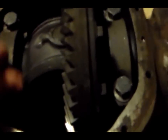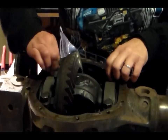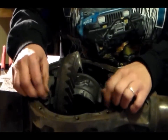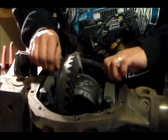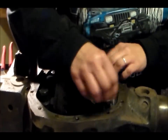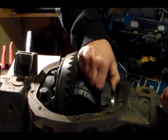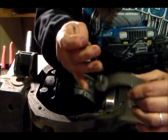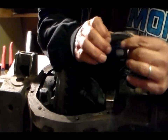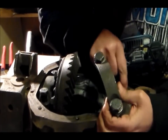You don't want to take these out and turn them around or put them on the other side — that would be bad. What I'm going to do right now is pull these bolts out. I'll probably put the camera back on the tripod because I need my other hand. Now we're going to remove these bolts — I've loosened them. Here's your driver side, stamped with the E facing down towards me, and so is the side on the carrier.